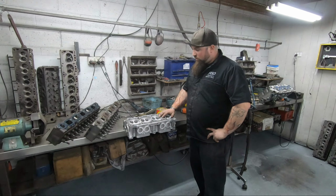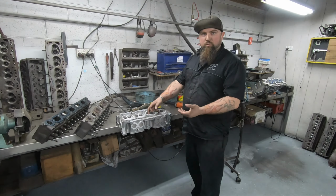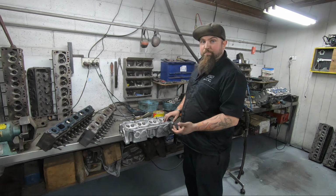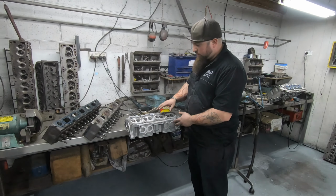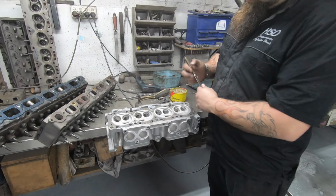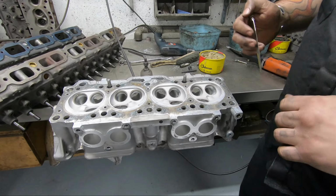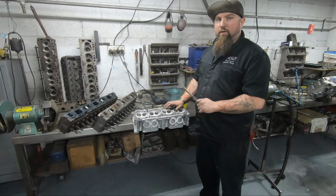So I've pulled the head out of the wash, cleaned all the wax that we poured, just to stop our burrs from clogging up and gumming up. Now, I touched on the short turn, that radius was one of the most crucial ones. It's very easy to stuff a cylinder head and go too far.